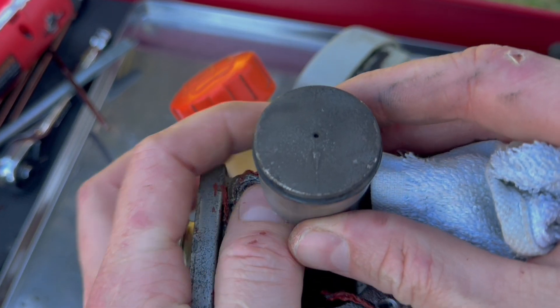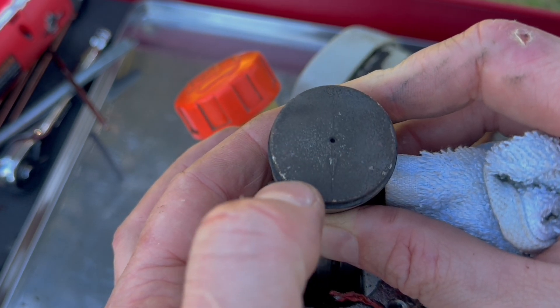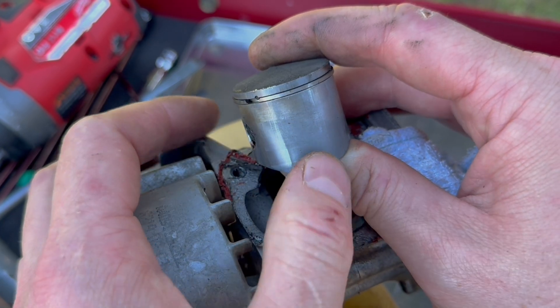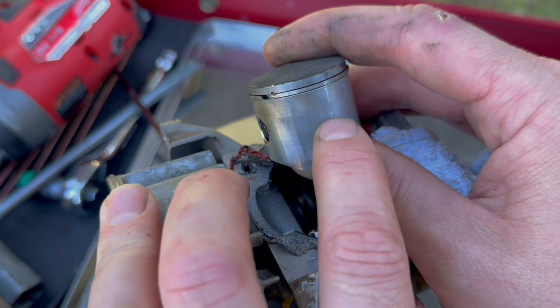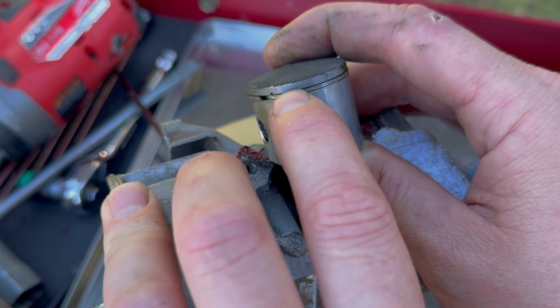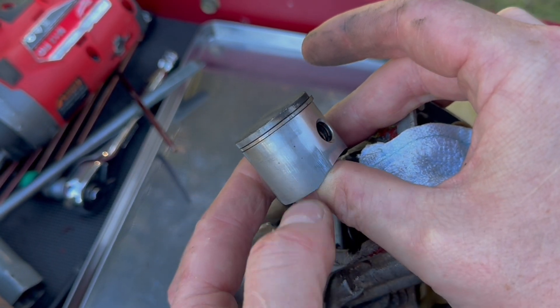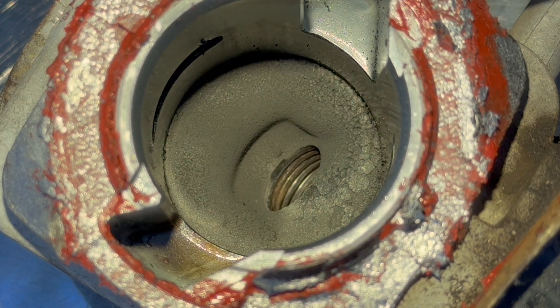The piston crown seems to be really thin because you can see through it in certain areas. Intake side: no real blow-by to speak of, maybe a tiny amount up here in the top left-hand corner below the ring land. No carbon to speak of above it — actually, a small amount there. Cylinder next: all around the squish band right around to the threads as well, there's a small lip of carbon on those threads.